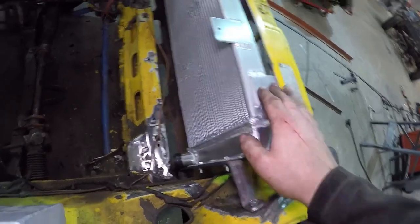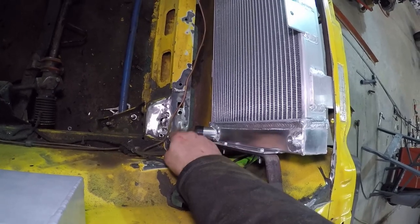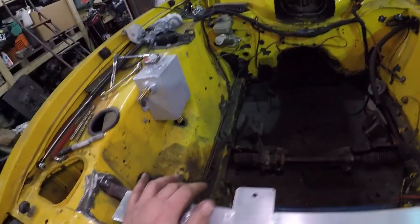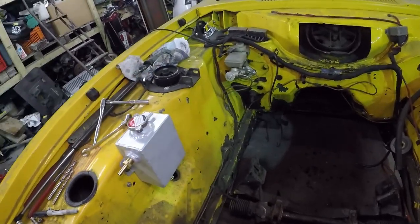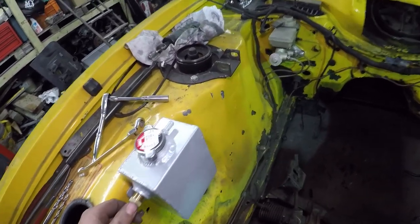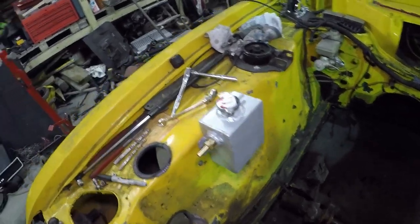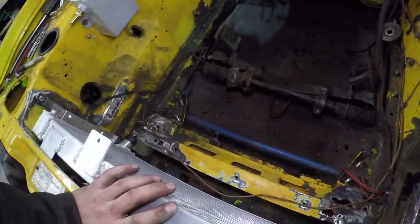The reason I kept it a bit higher for now is because I haven't got much space for the coolant fins where they come out. If it turns out I do have more space I might lower it down a smidge, because I've had to mount the expansion tank as high as possible to allow an air gap above the radiator. That expansion tank is horrific — the bolts don't even fit because they've welded and drilled the holes too close. But that's only temporary. Progress — the radiator is in.